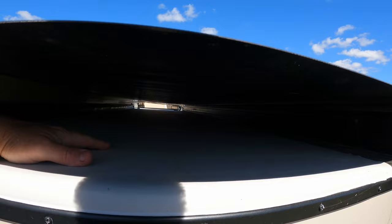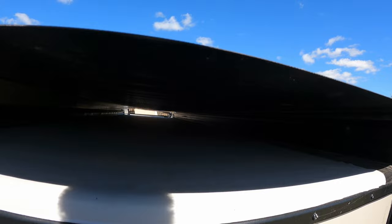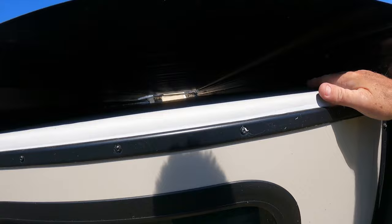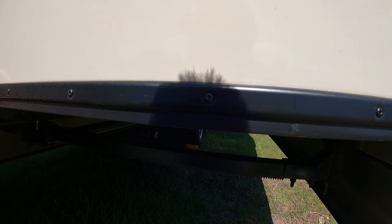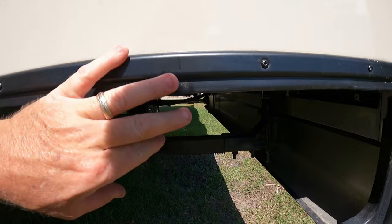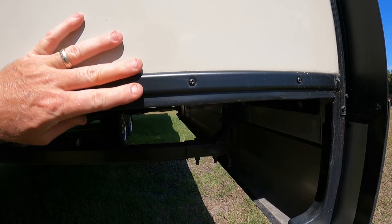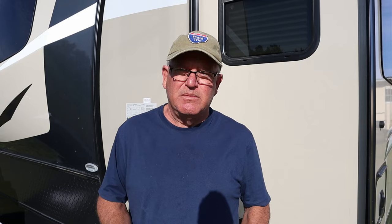While conditioning our seals up on top, we have a slide out cover which helps keep leaves from going onto the slide out, but damage can still happen. While you're up here you're able to look underneath and make sure you don't have garbage, leaves, or anything that could go inside and hurt your seal. Make sure the caulking is in good condition and where the tape meets it is in good condition. We also make sure our molding is correct, with no gaps and still sealed well, because rain will flow underneath. No rips, tears, or loose screws — that's a very big source of water damage.